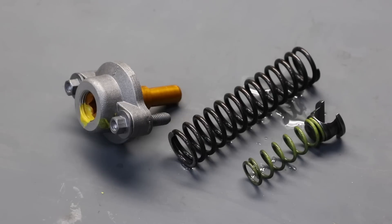The green one is the stiffest and would result in the exhaust valve opening slowly, resulting in a very smooth, slightly lower power characteristic. The yellow is the medium one, and the red would have the exhaust valve open quickly, resulting in a much more snappy, more powerful feeling.